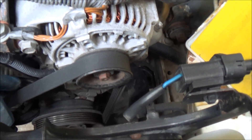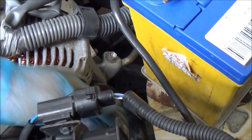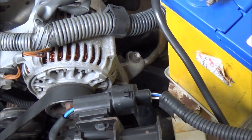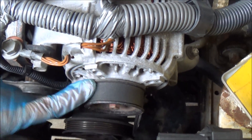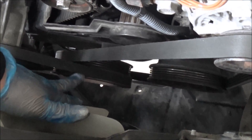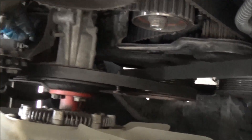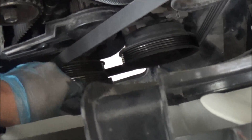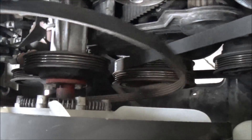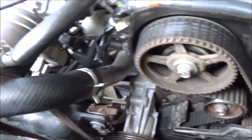The same story goes with the belt that drives the alternator — these are the alternator tensioning bolts. As you loosen this up, the tension drops and the belt loosens. So you just pull the belt off the pulleys. In that way you can get both belts off the crankshaft main pulley. The tension on the bolt is now loosened up, which enables me to slide the power steering pump towards the engine side, loosening up the belt. You can just get it off the pulley — the belt is free. You can leave the belt hanging like that; you don't need to fully remove it.